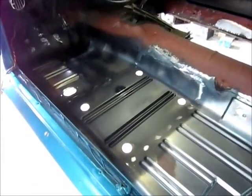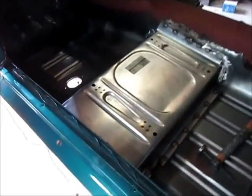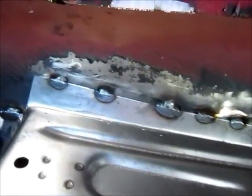Now I'm not worried about being pretty — it just needs to be in place and seal up the gaps. I'll also put seam sealer on the bottom later on when I go back underneath the car. Next step is to weld in the seat riser. And there's the seat riser. Now all the welds are in place and look good. You can see I just did the edge on that hump.